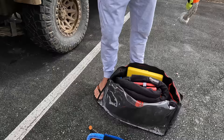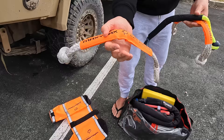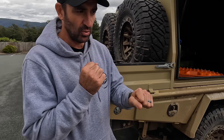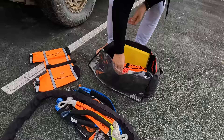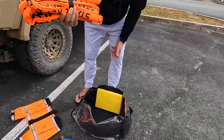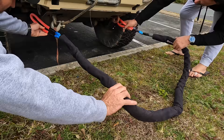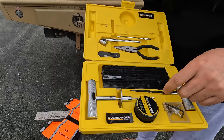That one goes on your tow ball hitch, and the others are for connectors and bridles. I got those from Drifter and they're 14-ton rated. Some are just for connecting snatch ropes, or you put them on when you put a bridle on to spread the load of the car weight. That's called a bridle. I've also got a spare winch rope and another bridle which can double up — instead of connecting to one chassis point you connect it to both sides and share the load, half and half.